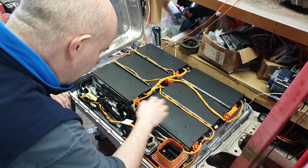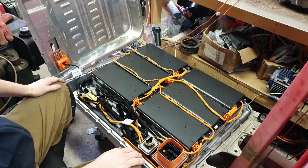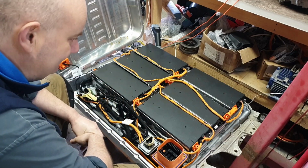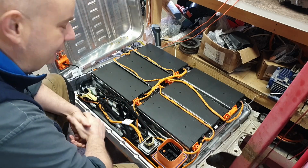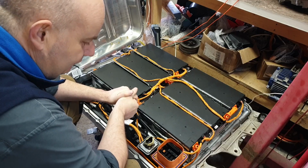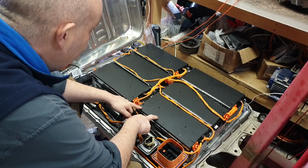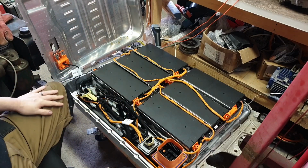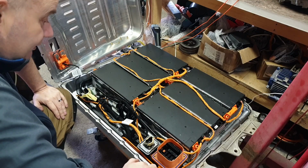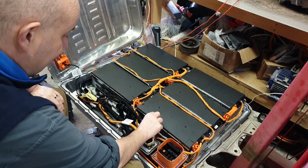Now, what we've got here are these Samsung SDI modules, which for those of us of a particular vintage can only really mean Strategic Defense Initiative. So these are my Star Wars batteries. So I'm going to be hopefully getting all 9 of these modules into our battery box. And these guys are going to be a 108S battery for, I think, something like 420 volts, I believe, fully charged. So this will be the first 108S battery that we're going to be using in a project as well.